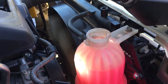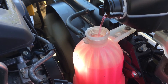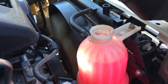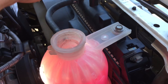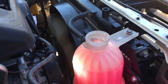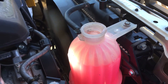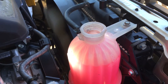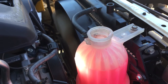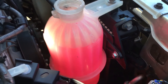That cap in the back of the picture there comes off from the top of the radiator. So when the coolant goes in that tube, instead of getting a bit of a lock and splashing everywhere, as the coolant goes in, the air comes backwards out this hole. This is the one I'm talking about right here - this is the highlight on the Prados, it's on top of this white tank. Once that thermostat opens this will drop down a bit - just a little bit of air in the top of the tank. It's going to flow and it'll all end up coming into this tank.